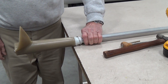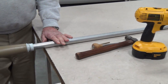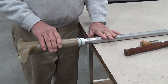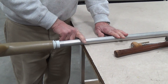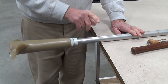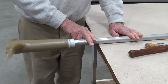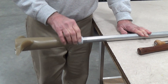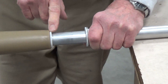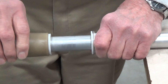This demonstration shows how to remove the propeller from the drive shaft on the Encore boat. This is the second generation drive shaft — an aluminum tubing drive shaft, which is a little bit smaller than the fiberglass one used for the first generation. That means it has another bushing in here that takes up the space and locates the propeller at this particular point.